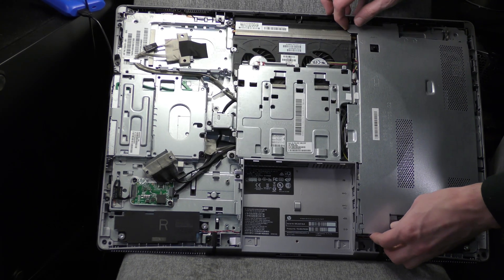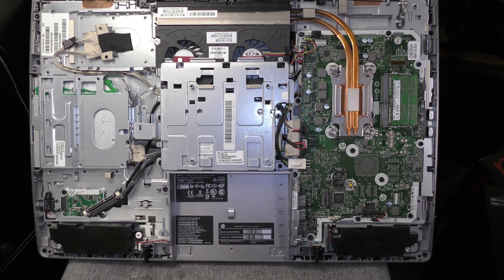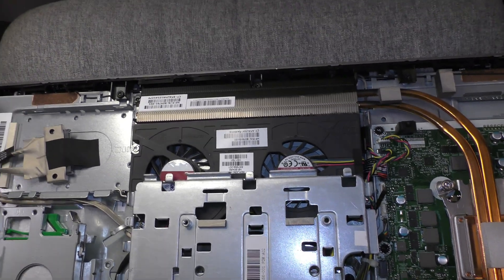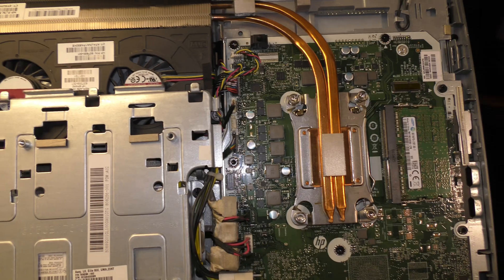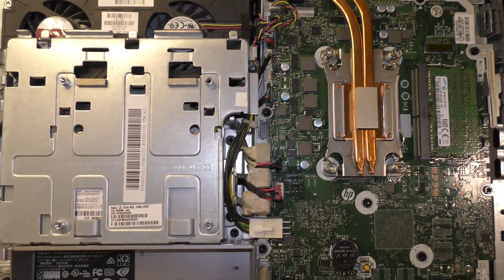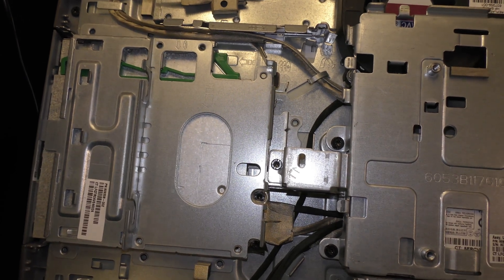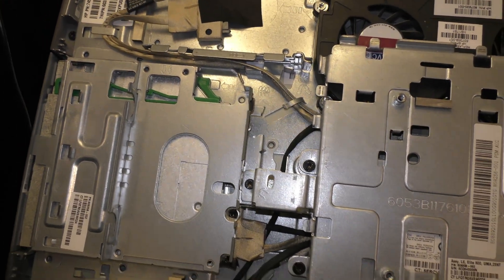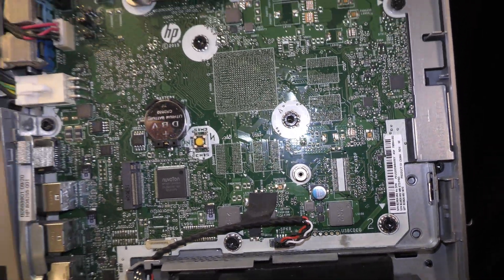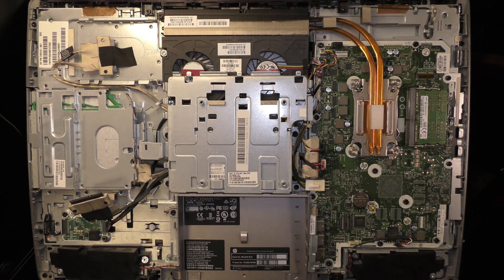Right here we have our CPU fan, and this has an Intel i5-6600 — that is a quad-core CPU running at 3.3 GHz base clock rate and 3.9 GHz turbo boost. Over here on the other panel, we have our heatsink, and then the RAM — it came with two 4GB sticks of DDR4 2133 MHz. It also has a couple of speakers. Looks like two bays for a 2.5-inch hard drive. I was pretty pleased to see that it has an M2 slot on the board, and neither of the all-in-one's counterparts — the micro tower or the standard size desktop — have that M2 slot. Hopefully we'll be able to boot from that.